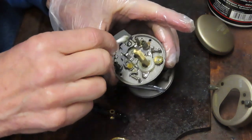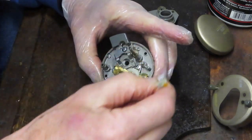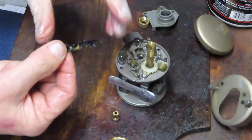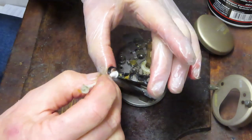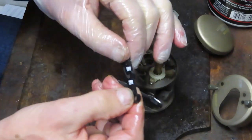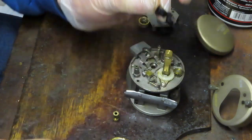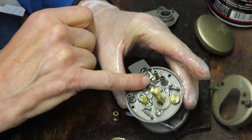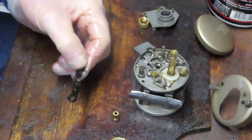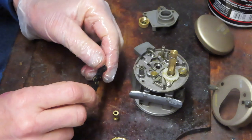In this case it's all clean — there's no indication other than a little bit of grease around one post that there are any issues. So we're just going to add some grease onto the shaft. Now this one is almost impossible to get wrong when you reinstall because one side is longer than the other. But sometimes you have to pay attention to ramps — the ramps go towards the release. These two little spring lever type things are going to ride up and down on the ramp and pull in or push out the spool gear or the pinion gear. Pay attention to that when you take them off, and it's a good place to take a picture.